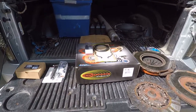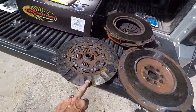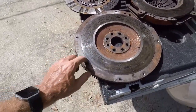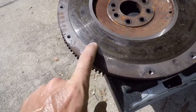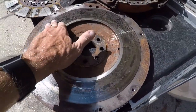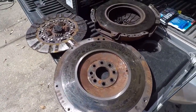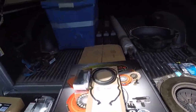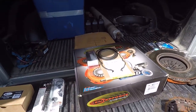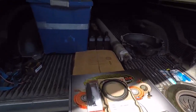I'm real interested to see what this truck is supposed to drive like, since I don't know what that is — the transmission has been screwed up ever since I bought it. What I can't believe is that even without all these pieces it never really got into the flywheel. It wore cockeyed. You can still see some of the Blanchard grinding from the original, but it's burned. I can't see any cracks, but it's not smooth. I could have had it surfaced or spent another $500 on the nice aluminum one, but why bother.